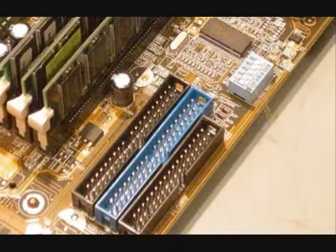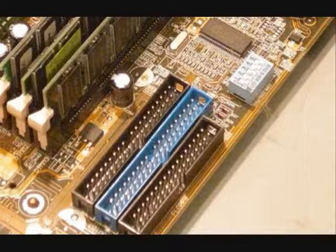Next, the drive must be connected to the motherboard. All IDE motherboards will have two IDE connectors, and in this case, one floppy connector. Again, this connector is keyed and will only allow the connector to be connected in one direction. For users who have a motherboard like the one shown in this picture, the blue connector is an indication of the primary IDE connector. If your motherboard does not have different colored IDE connectors, you'll have to read the text next to the connector to determine which is the primary and which is the secondary.